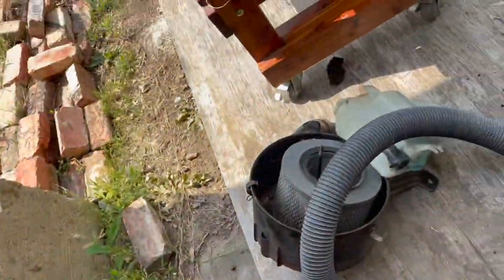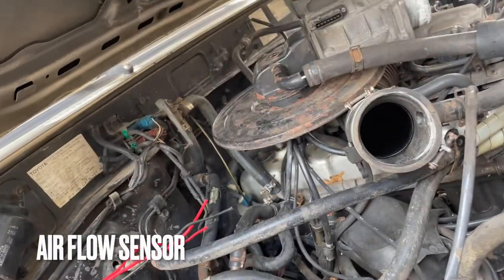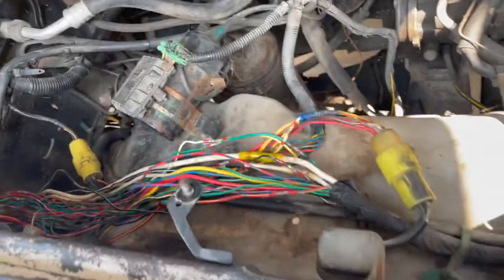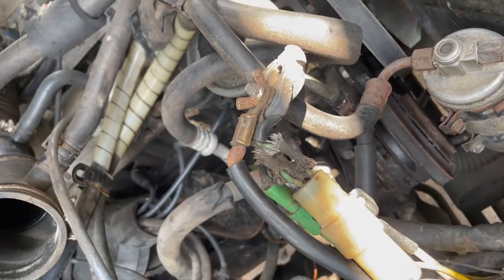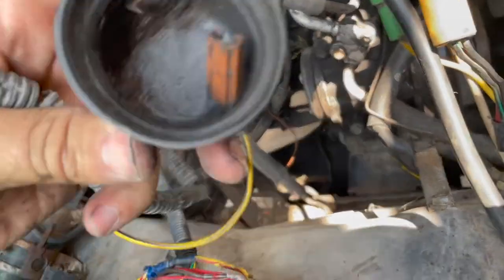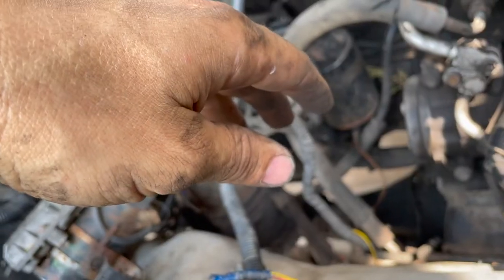We took the air box out just to gain access, and the washer reservoir. We're going to put the air box back in so that we can hook up the throttle body connector and hook up the intake and see if it fires up. The only thing that's been changed is the oil pressure sender switch — it's been changed over to a mechanical gauge at the bottom of the oil filter. If we can get the right sender, maybe eventually we'll change that back so the factory gauge light works.